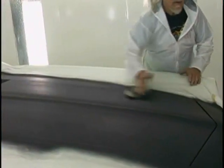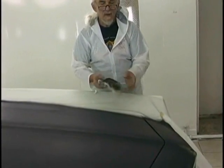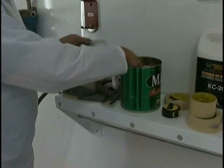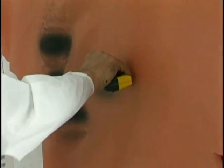Now look what we're picking up on our tack rag, tacking the sealer. Always a good idea to tack the sealer. Now that tack rag got pretty well trashed, but I'm gonna keep it anyway. I keep a couple of coffee cans, one with good tack rags and one with beater tack rags. Again, the band pass, tight pattern overlap.